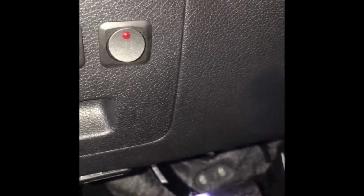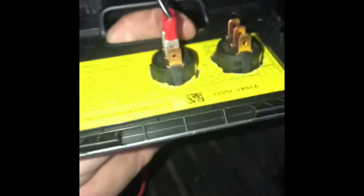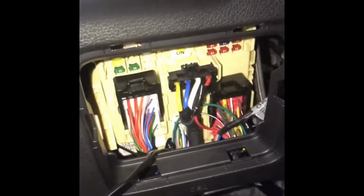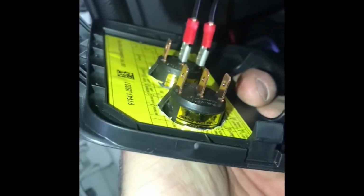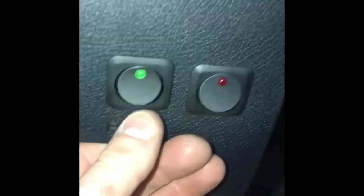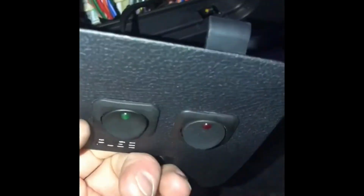There's my brake boost switch, and that one is my four-wheel drive on-off switch. These little rocker ones look nice and clean, different color, and I did red wire for this one, so I know which one's which when I pull them through. And it doesn't matter which one's which because it's just a switch. The two bottom ones there, and I can put a power to the third prong if I wanted the light to illuminate, but it's going to illuminate when the switch is connected, working normally, and I don't want that to be on all the time.